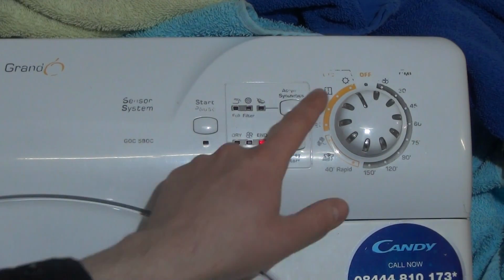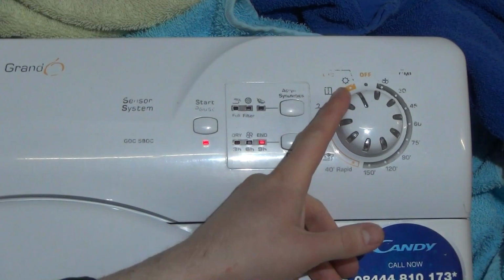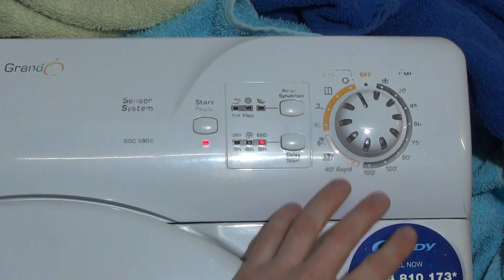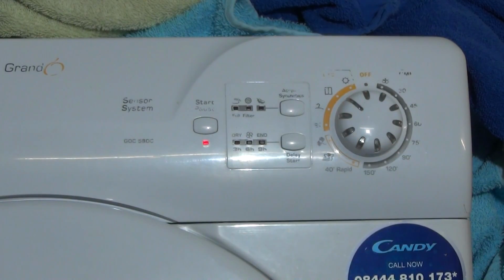Right, so the first mark in here is the extra dry setting. So this is for multi-layered fabrics such as jeans and stuff like that, where you've got more than one layer. Cupboard dry, these are for thick fabrics, or shall I say a mix of maybe light and heavier fabrics. Gets it completely dry.